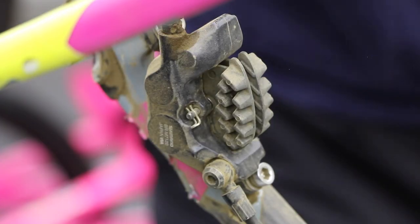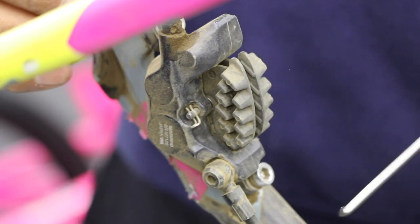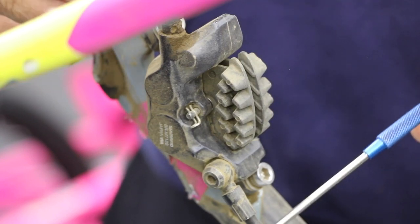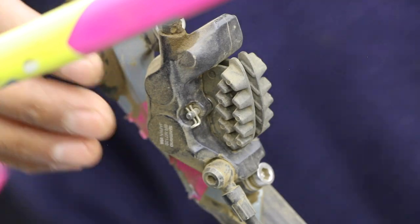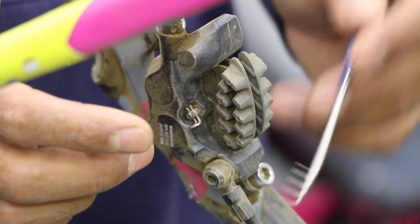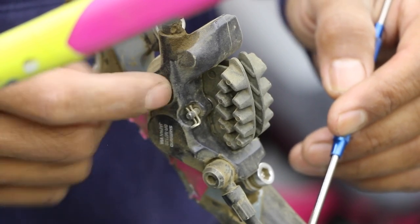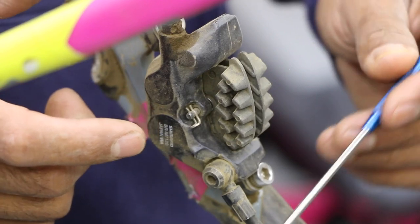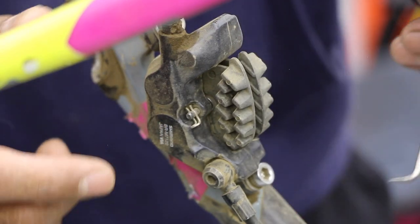These are Shimano SLX, and they happen to be 4-piston. Very uncommon to find this on a cyclocross or gravel bike, unless you're a big guy on a large bike, XL, pushing 200, 250, 300 pounds, then I could see a 4-piston in here. But even the rear is pretty rare to have a 4-piston back here. The rear just locks up so easily. But I had these lying around, pulled off another bike, and I wanted to experiment. I am running a Shimano shifter lever combo set.